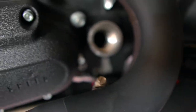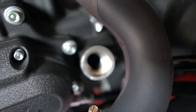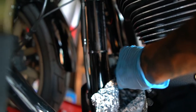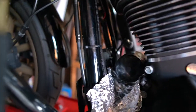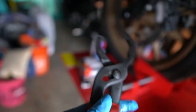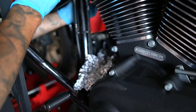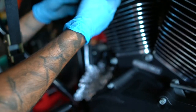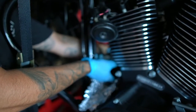Quick little tip: to get some airflow when draining the oil, take out the dipstick so you let it release. I was having trouble taking out the oil filter because there's not much space. There's a little cap that goes on and you put a wrench to it. I had to remove the horn to get more space to work with, and finally was able to loosen up the oil filter and drain the rest of the oil.